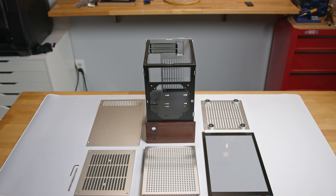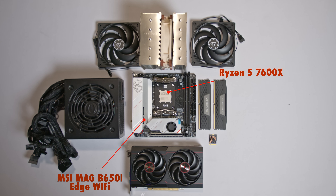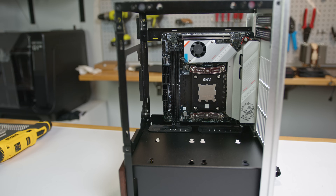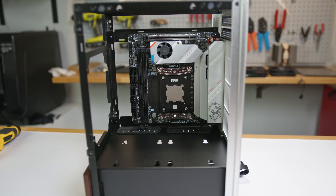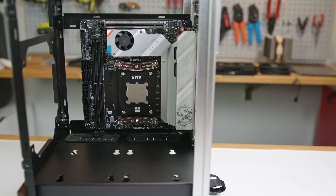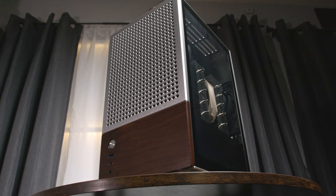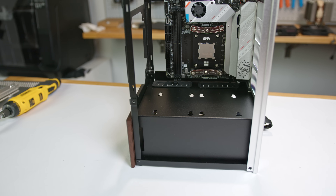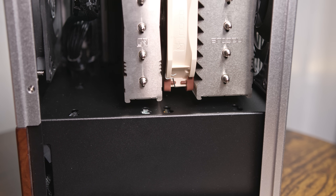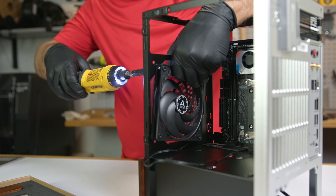With the left, right, top, and bottom panels removed, I was ready to assemble a PC. As with most small form factor builds, I had to reconfigure my typical component selection to fit the various size restrictions of the case. Starting with the motherboard, the T6 is purpose-built for an ITX board, or the very short-lived and apparently abandoned DTX form factor. You may also notice the motherboard is installed upside down, which allows the graphics card to pull fresh air from the top of the case and explains the inverted orientation. There are two mounting locations for 2.5-inch SSDs below the motherboard, though the ability to install them will depend on the CPU cooler you select. You can also mount a 120 or 140mm fan in the front of the case, and a 120mm fan in the rear.